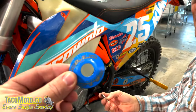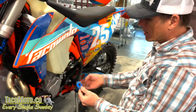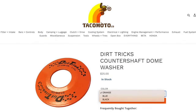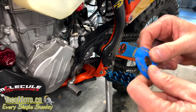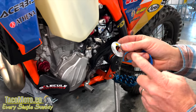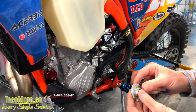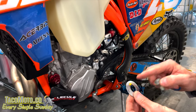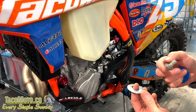This is what you're looking for right here — this is Dirt Tricks. So this stock one is just mild steel, and this is a tool steel. This has basically lifetime spring preload capacity. KTM would recommend that you change and replace this anytime you ever disassemble it to change gearing or whatever. Really, this is a replacement item — it has a service life.